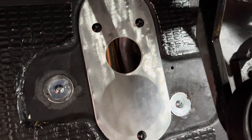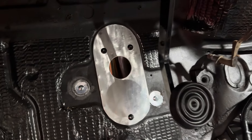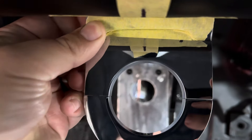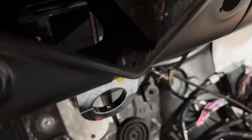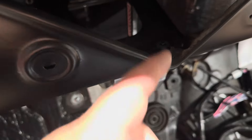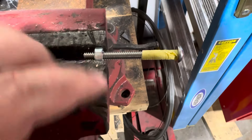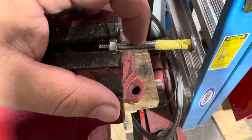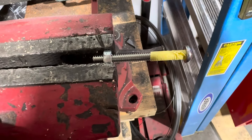I had some M6 titanium bolts left over from when I did the firewall and they fit perfectly into the factory holes. Just to secure it better I put a lock nut on the back of it. I've also found my center marks here on the dash and I've got to go ahead and drill out one side because it's just a hair off. Everything fits good but I'd really like it if those bolts were a little bit longer, so I'm going to take it back out and get some threaded rod, cut it down, and make longer bolts. I went to the hardware store — they had threaded rod in quarter-20. It was zinc coated, but I opted to spend an extra dollar and got some stainless three-inch quarter-20 bolts. To cut bolts: put it in a vice, thread a nut on first so you don't mar the threads, and when you back the nut off it'll clean up the threads on the cut end.